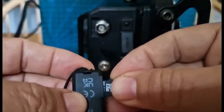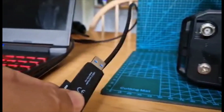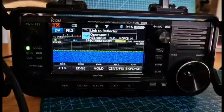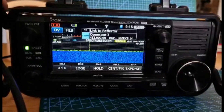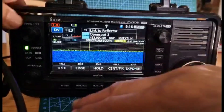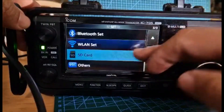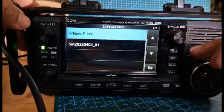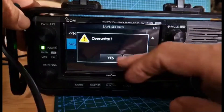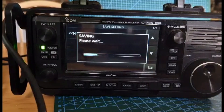I never use a cheap adapter. Put it in the adapter and that's going into our laptop. You need to have used the SD card at least once to have the necessary files on it. With the SD card in, go to Menu > Set > SD Card, then save your settings at least once. Click yes and all the files you need will be on the SD card when it goes in the PC.